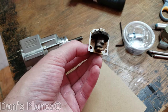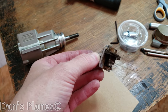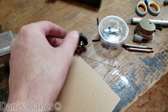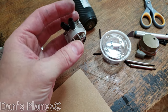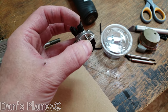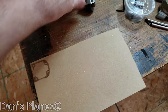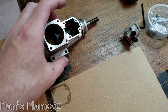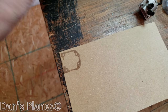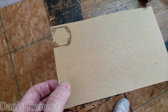I was able to remove the cam after heating at a little over 200 degrees, probably about 215 for 20 minutes. I got that to pop off. Of course, the gasket is toast now. I had to use a small blowtorch on it because the plunger thing in there just was not moving. But now both of them are moving, so I'm ready to put it back together. I learned from Aero Scott: if you put some oil around the surface where you want to make the gasket and then press it down on some cardstock, then you know what to cut out. You can just use cardstock as your gasket — same thing with the valve covers. Pretty cool little trick.